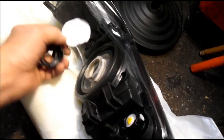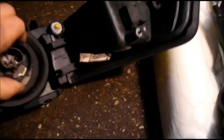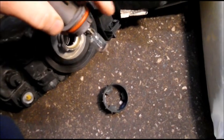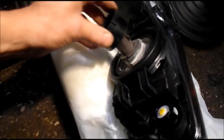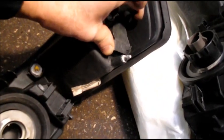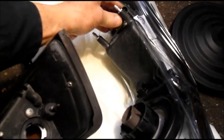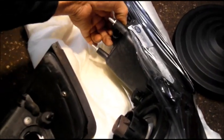So you take this little clip off here and just throw it away. There's another light that goes right here — take that off. Then you remove this light here: you just take it, rotate it, pull the clip off, and take your light out. Don't touch the headlight bulb — you don't want to touch that bulb because you'll burn it out. Put your new light back in, push it in, put your clip back over the top, and tighten it. For this other socket, it's counterclockwise to take it off, clockwise to put it on. Take it out, and we're just going to put our new one in — there's only one way they can fit, so remember how you take it out and put it back in the same way.